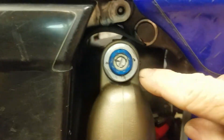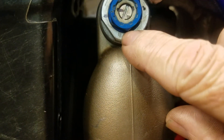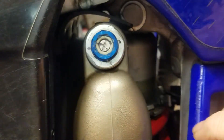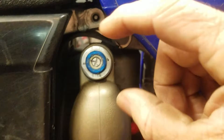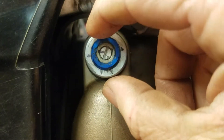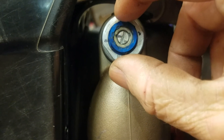You're just taking tension off a little spring in there for the shim that bypasses the low speed compression. So through time, I seem to add a little bit more here and there to kind of keep the same feel. But it doesn't take much to feel this thing. Once you have it in its range, if you want the rear end a little bit firmer, you're only going to want to turn it like that much.